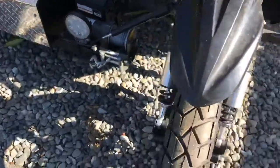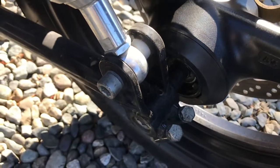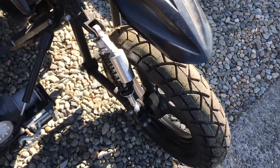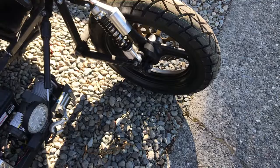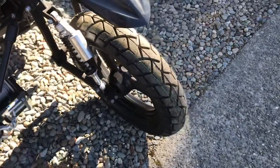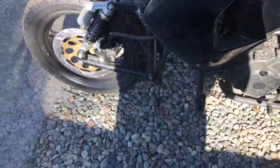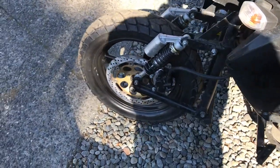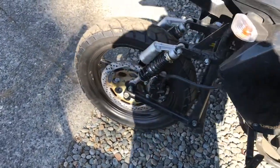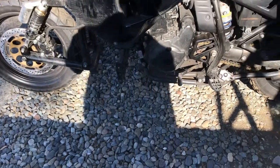The KLR speedometer does not fit on the GS wheel, and the GS speedometer runs a totally different cable than the KLR does. I can't find a long enough GS500 speedometer cable, so as of right now I do not have a speedometer hooked to the bike. What I use is a speedometer app on my iPhone that carries over the odometer, so I can use that for my fuel and just reset it when I fuel up the bike — which works out really good. It was like four bucks for the app. I'm still experimenting with some other apps to see which is the best — the one I've got now, I forget the name of it, works pretty well.